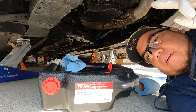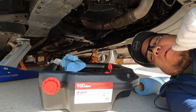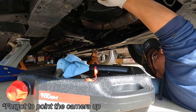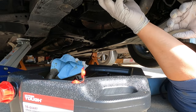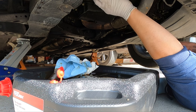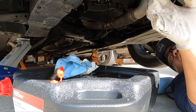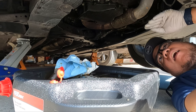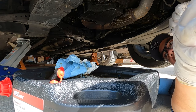Next, we want to take this oil filter off. These are not supposed to be super tight — they're pretty much hand-tight. I know some people will use tools too, but they're not really supposed to over-tighten them. Let's see if we can get it off. There you go — see, it's moving. It really is hand-tightening. Now this is going to be a mess. I'm going to use the hand that does not have the Apple Watch on it. Now slowly try to get as little spillage as possible, which is not possible. What's nice is this one goes straight down. Some cars, it goes to the side — on some of the older Toyotas, it goes from the top down. Not a big fan of that design.